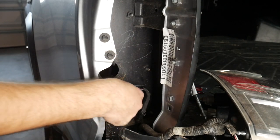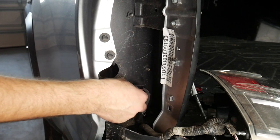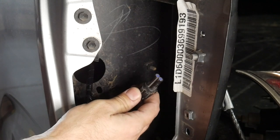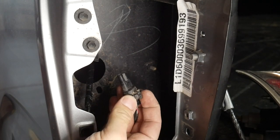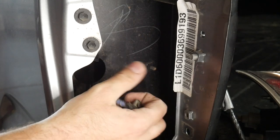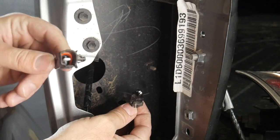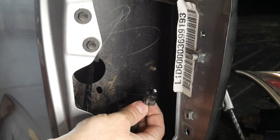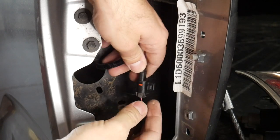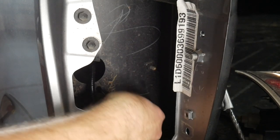Next step: I would suggest going from underneath the truck and popping out this plastic cap first, because the cap holding the extra harness in place is no longer needed. Get underneath and push it out. Once you get this cap popped out, you'll see this is just a simple holder — it pinches and you've got to kind of hit it out. Not the simplest clip to remove, but just hit it from the other side and it'll pop right out. Take the actual piece out — this you can dispose of. Here is the part that's going to plug in — again, only goes one way, like so. Then take your clip on the actual lighting kit new harness and click it in. There you go, good as new.